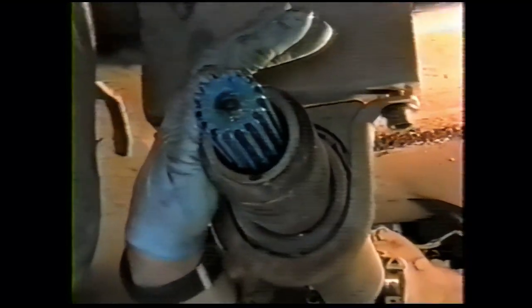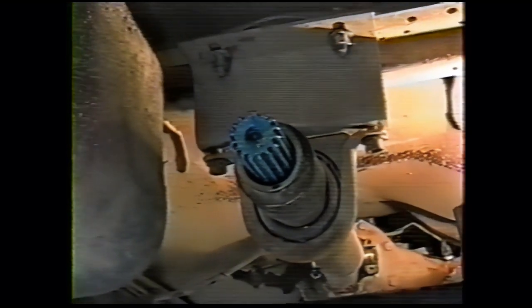This upper bracket is adjustable, and I did end up moving this one back just a hair to get it to line up. But the slots have to be all the way towards the back as a rule on these club cabs. Now we're going to put Loctite on the bolts that hold the drive shaft in place to the transfer case output yoke. If you're using our new replacement clamp and bolt kits because your bolt heads are rounded off, they have locking patches on them, and you wouldn't need to use Loctite the first time you use them.